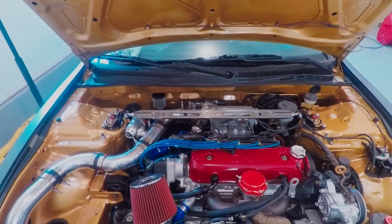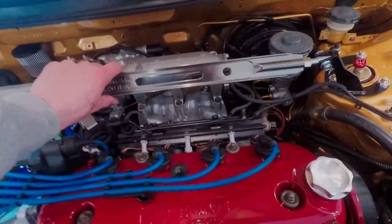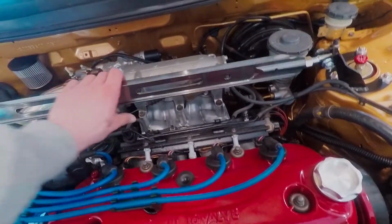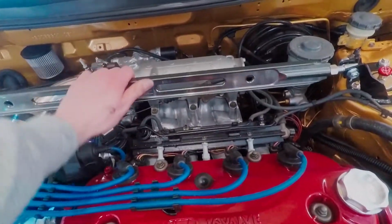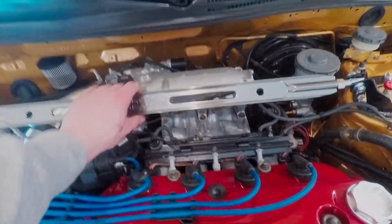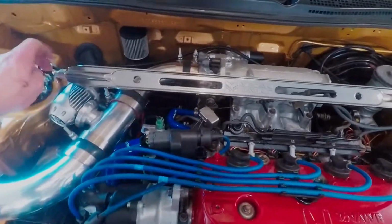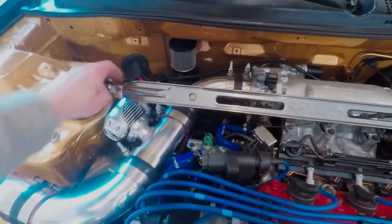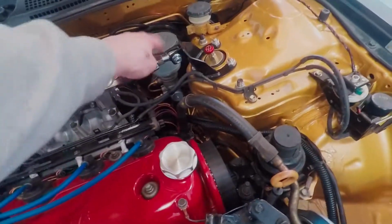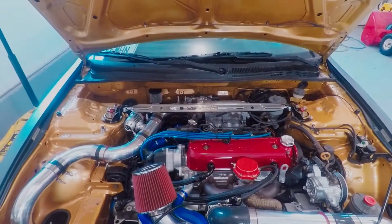But yeah, I'm going to crank this thing pretty tight in there, which I already have, just to make sure that we're pushing out enough on our struts. Maybe that one might be good, because then there's definitely some tension that we're pushing out on the actual struts themselves. So we'll just crank this down, crank the other one down, and we should be good to go. But yeah, so that is the strut bar install. Not as bad as I thought.